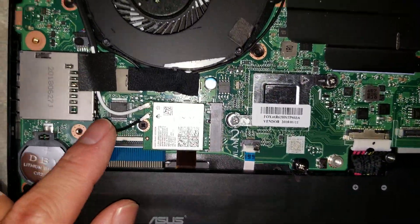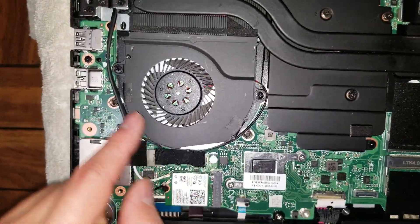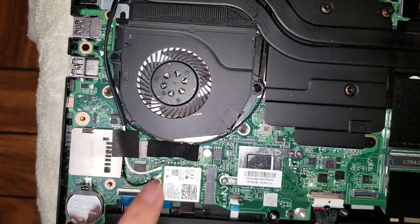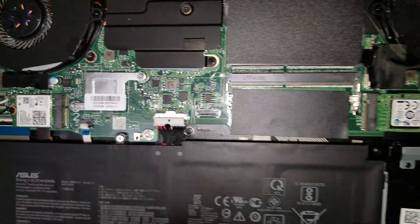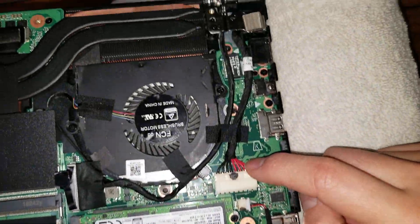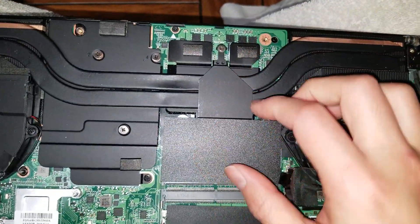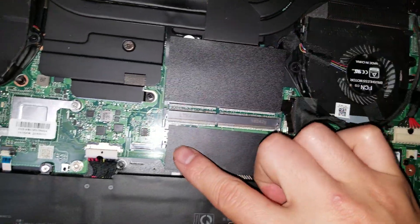So you can see the wireless card here, and the wireless antennas go up there. There's the fan — you can actually remove it by just taking the two screws out and then the connector. There's also the CMOS battery, the keyboard and backlight connector, the trackpad connector, the speaker connector, the charging port, the LCD connector, and the other fan. There are two RAM slots — one is already occupied and there's an open one available.